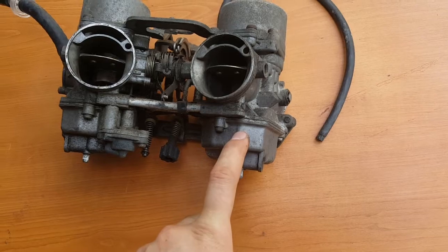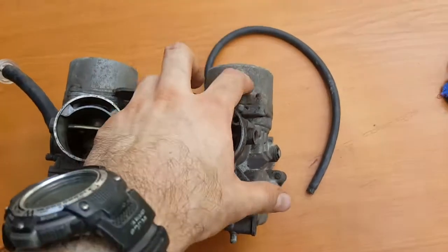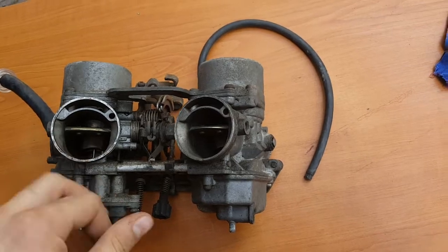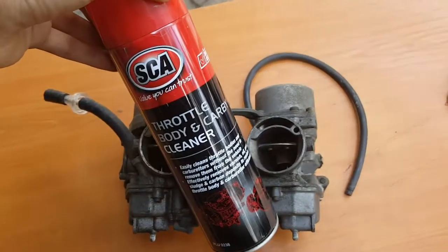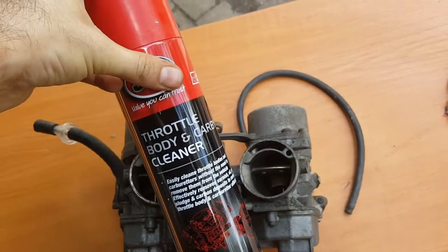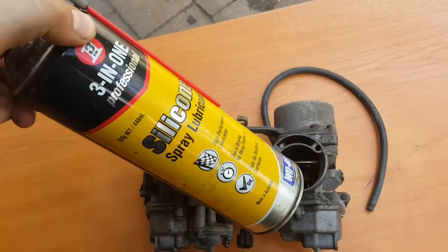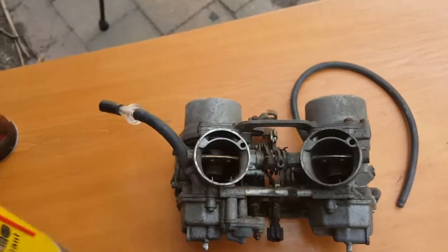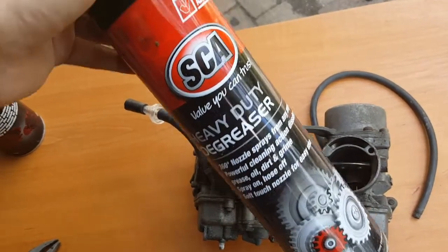First I will drain the bowls and take them off, check for gunk inside, clean them out, and take the sliders out — generally just get them out of this gunk and give them a good clean up. Things I'll be using: carb cleaner, silicone lubricant because something's bound to be stiff, and a degreaser to get rid of stuff. If things go really bad and I have a stuck nut, I've got penetrating oil for that.